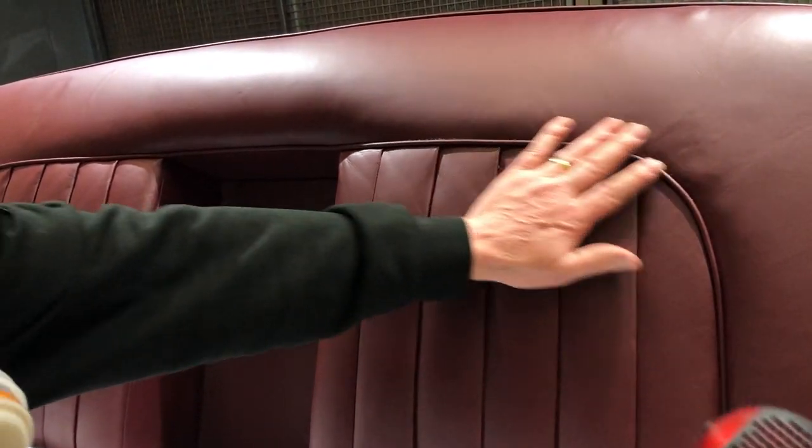Things like ceramic coatings on leather are not advisable because they're a solid material and your leather needs to flex. Your leather needs to be able to flex. So with a ceramic coating on there, because of the nature of what a ceramic is, it seals absolutely everything up. Leather will have like a 1% breathability, even with the lacquer on.